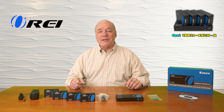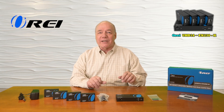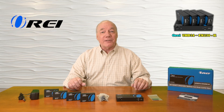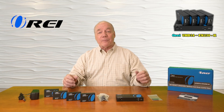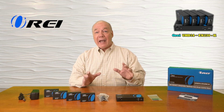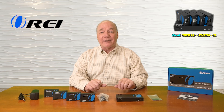It really is just that easy to get it working. The O-Ray UHD14-EX230-K HDMI splitter and extender kit was engineered to make it really easy for you to share all of your HDMI media content with four remote locations at the same time over a single CAT6 or CAT7 LAN cable. The product fully supports 4K ultra high definition media content at up to 60 frames per second and is both HDMI 2.0b and HDCP 2.2 compliant, making it completely compatible with all of your modern media gear.